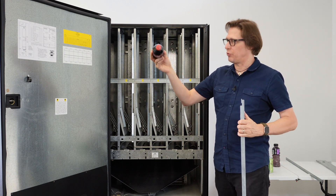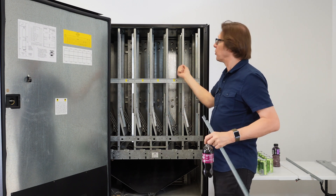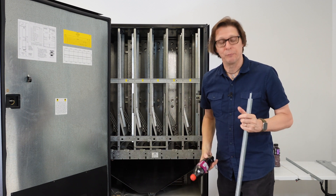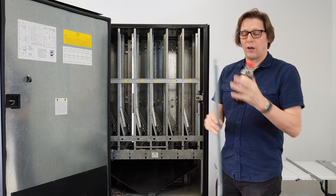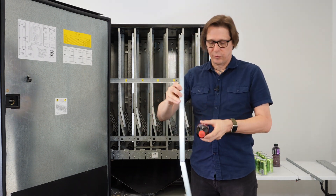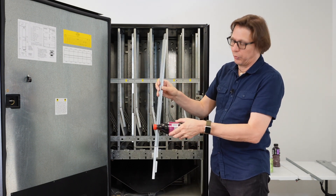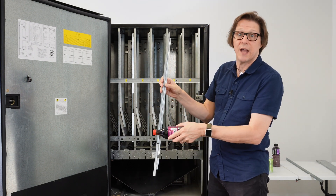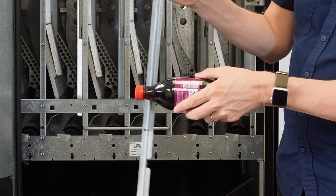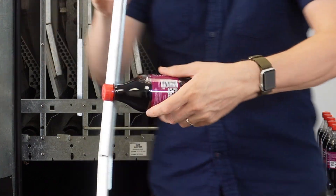As the products are being vended and drop down, that drop is going to cause the product to move forward. The last thing we want is when you open the door, all of these products topple out on top of you. So you have these spacers to adjust that. For bottles, we typically like to put the side spacers into the neck of the bottle so it sits between the cap and the body of the bottle, right in the neck, to stop the product from falling out.